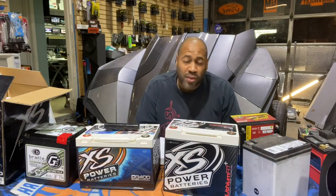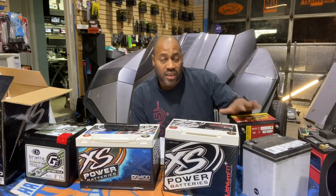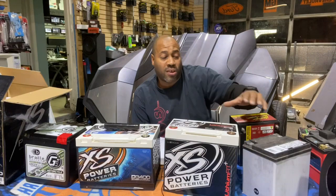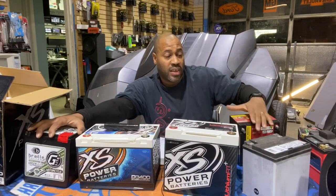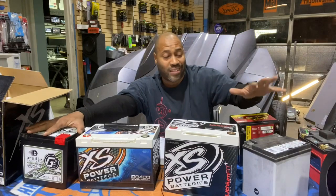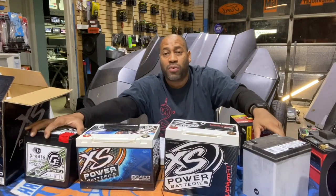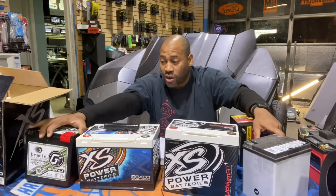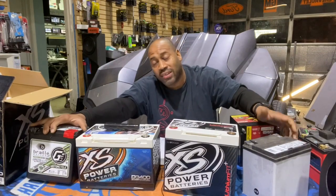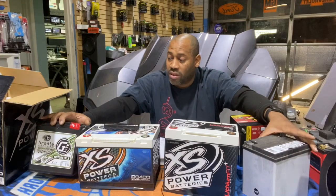My last video scared a bunch of people. I got a bunch of emails when I said these batteries do not like to get cold or be frozen. What I meant was you can't charge the batteries when they're frozen. We've tested the lithium versus the AGM versus the stock battery, and I actually put the batteries in the freezer. The batteries all suffered and all lost output. The lithium battery still outperformed the AGM and the factory battery by 90%. The discharge was slower and it gave out less power, but it was still 10 times stronger than these other batteries. The only thing is, when the battery was frozen, it wouldn't take a charge. It gave up current, your audio will still work, your bike will still play, it's just that when it's below 30 degrees, the battery won't take a charge. I don't know anybody, well, I got some crazy customers that would ride their Harley in 20, 30 degree weather. So the battery will give you current.